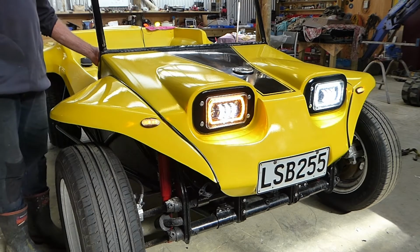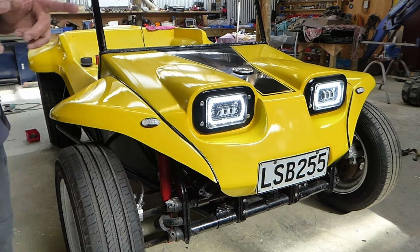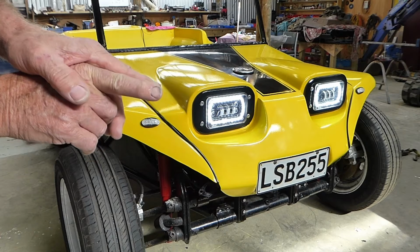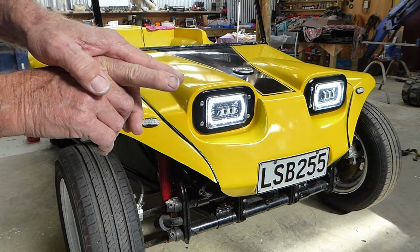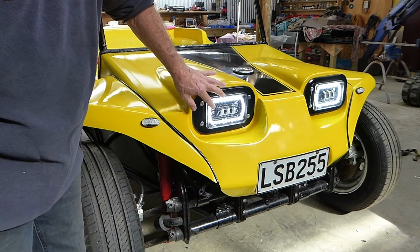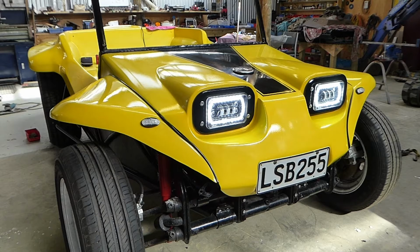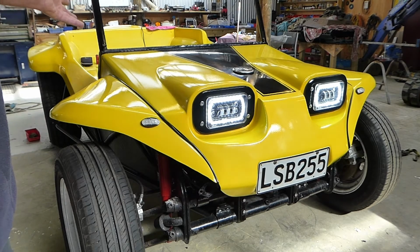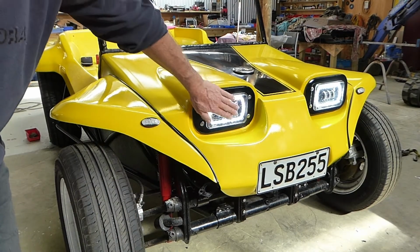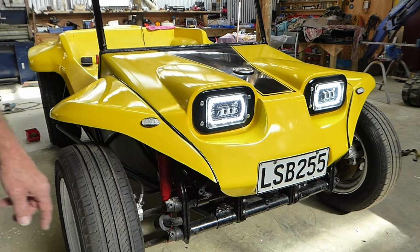So I'm not quite sure. I think there's a relay for the high beam and a relay for the low beam. And the low beam relay's park off position is the power that goes to the DRL. So the DRL is getting its power from the low beam relay. That's why they're going. But it doesn't work with the other stuff. The DRLs are off, it's not going, but there's something wrong. I think that the feed trigger wire onto that high beam is not going.